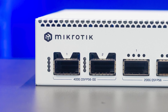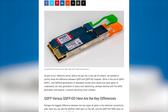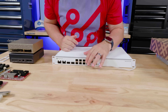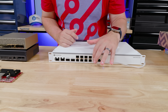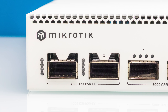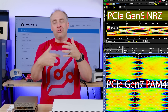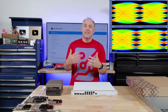Now let's talk about what you can actually do with this. It uses QSFP DD — the basic idea is that there's an additional row of contacts beyond a standard QSFP adapter, which gives you two times the number of electrical contacts. When we say QSFP56DD — double density — the Q means quad (four lanes), so QSFP56DD doubles that. Think of the eight SFP56 50 Gbps ports: that's essentially what this 400 gig port is — eight lanes of 56 gig, or 50 gig PAM4 modulation.